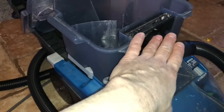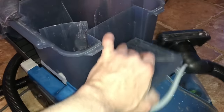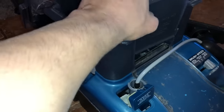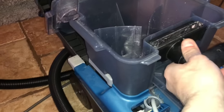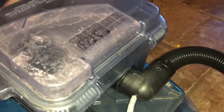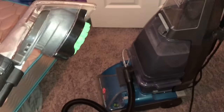Now when this is flapped down, that means the hose can be used. If this piece right here is flipped up, now it's got suction at the head — so you can't use the hose tool. So again, flip it out, put this in, put the dirty water tank down. Locked in place — good suction, good lock. Now the handle can be used. It's hooked up and we've got the scrubber handle on.